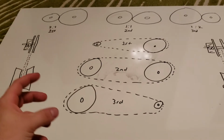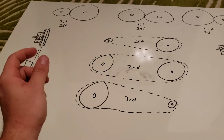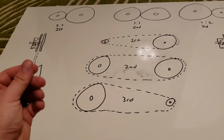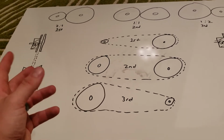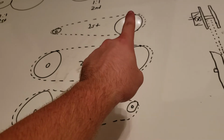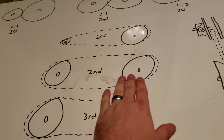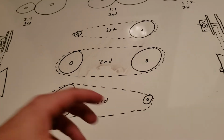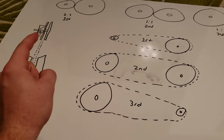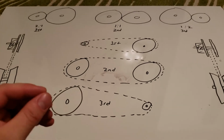And there actually has been talk about how the factory spring sometimes, if it's heavily used and it hasn't been maintained, like there's a little grease nipple on there that you're supposed to service. You just want to make sure dust and silt are cleared out of it, just general maintenance. But sometimes that spring can stick. So it will never get back to being small in the front and as big as it can be in the rear. It will stay smaller than it should. So by upgrading that spring in the rear driven pulley, it is managing the gearing a lot better on the fly than just the factory spring.